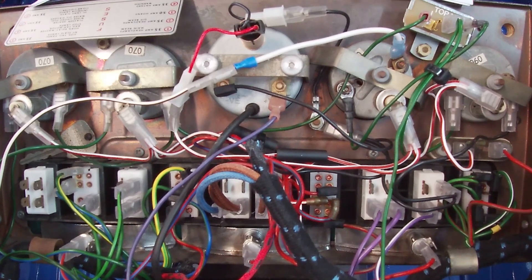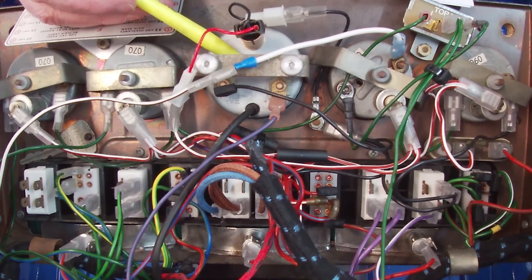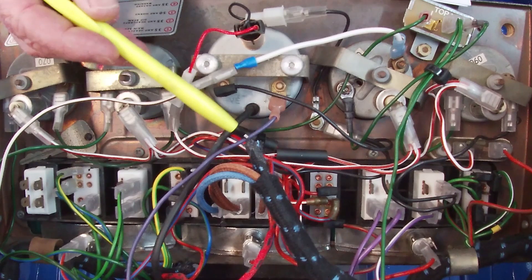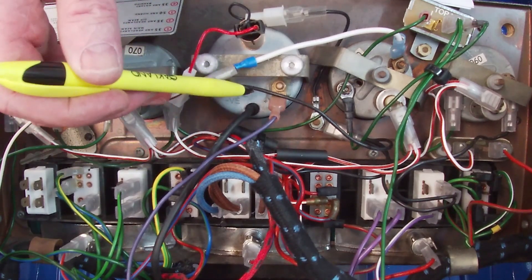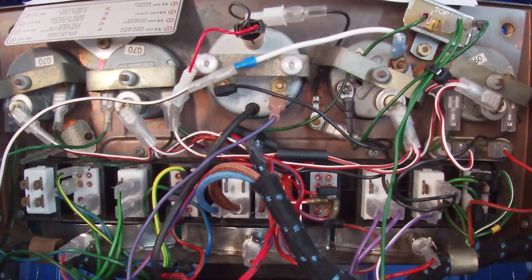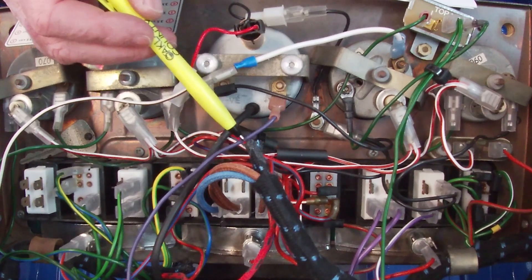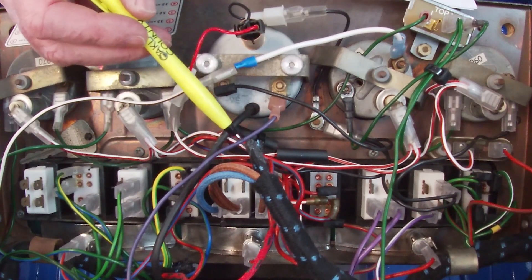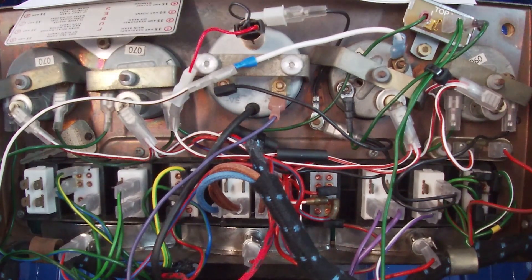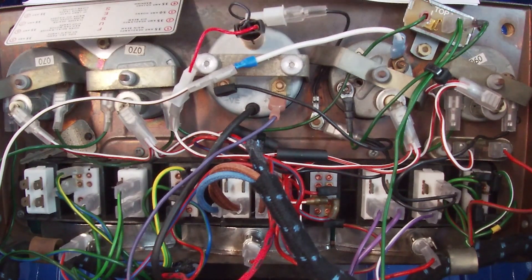I have a brand new clock and I picked up a live feed through this purple wire, and then I have an earth for that. This purple is part of the original loom — I had to take that off my old harness because it's not included in my ancillary pack. Red and white wires go to illuminate the gauges. This is the voltage stabilizer — I think this side is the 10-volt, this side is the 12-volt.